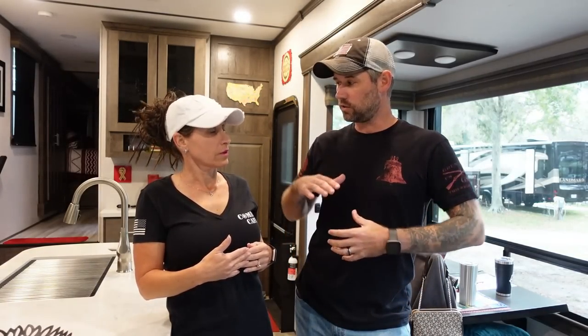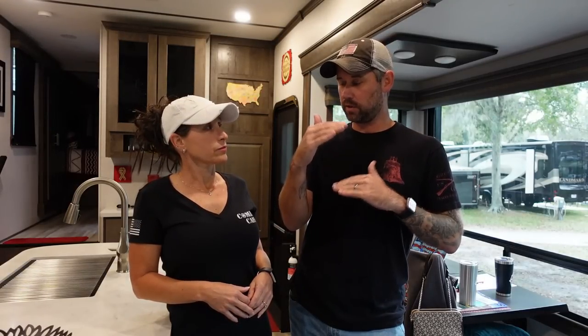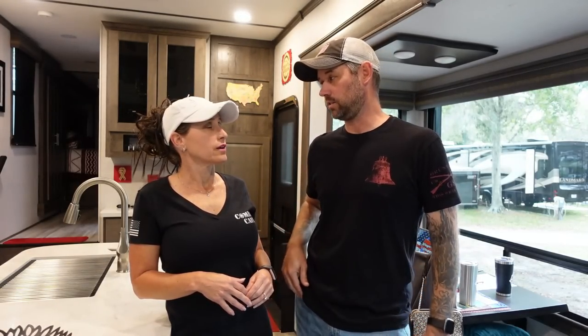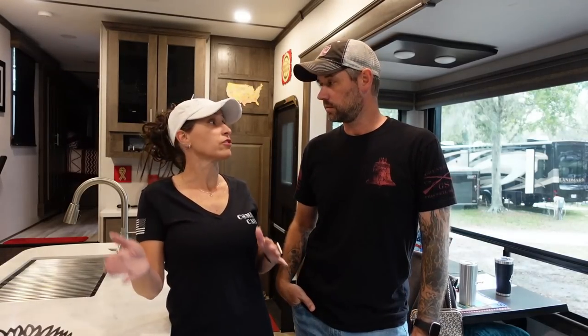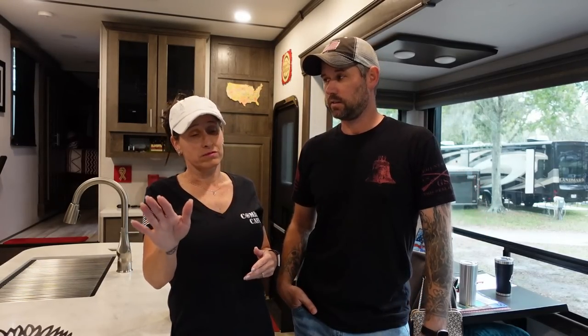I think that's because you get the high pressures in the back of the truck, and there's nothing in the truck bed to weigh it down. So you got that bounce and that big gap between the old bump stop and the shock. But now that gap's closed with the Sumo Spring. So even unloaded, it's not nearly as bouncy. It was a pleasure actually driving from the last RV park to here, even over the bridge seams and divots in the road, the chunks that are missing. Normally we feel the impact and hit hard. Sometimes butts leave seats. Not the case anymore.